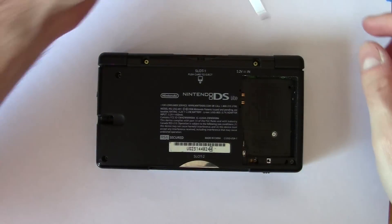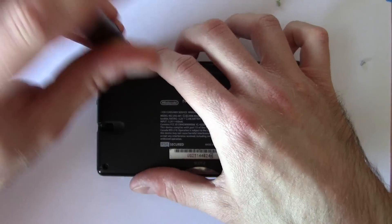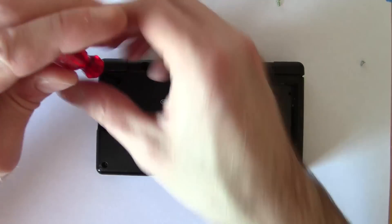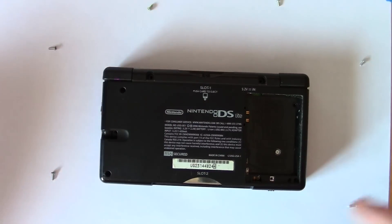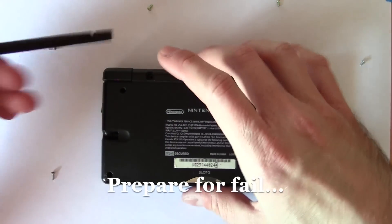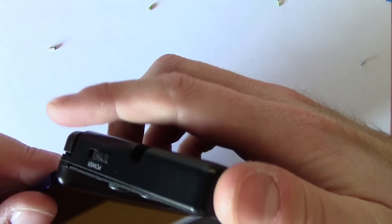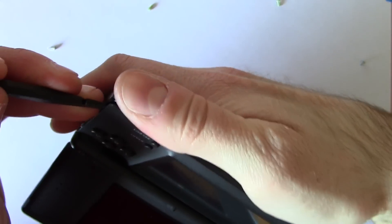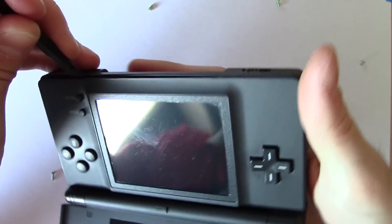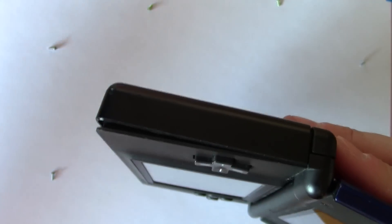Let's get that Phillips head screw taken out here first. A magnetized screwdriver comes in very handy for something like this. Now the other two screws underneath those covers that we pulled out are also Phillips head. Let's break out our tri-wing and remove the three remaining tri-wing screws. Now we've got nothing holding this bottom case on except a couple of snaps, and this is where the spudger comes in handy again. Simply open up the DS Lite and you'll notice that the casing is starting to come apart. If you start to pry up the back, you'll make a little gap — stick the flat end of your spudger in here and just gently run it along. You'll eventually hear some cracking and snapping — those are the internal snaps releasing. Once you get about three-quarters of the way across, the thing will start to come apart on its own.